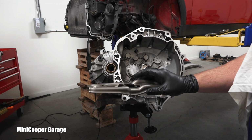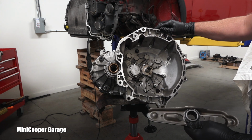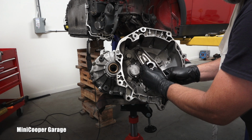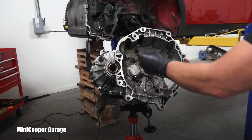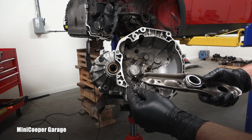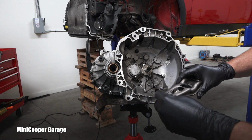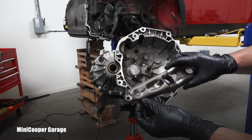To install this whole thing, the lever with the bearing, it's basically the opposite of what I did just 20 minutes ago. So I will introduce it simultaneously up here, but also watching that throwout bearing. To make it easy on myself, I will actually remove that retaining clip, right. I will first install it on this lever, right, it's easier, and I have it in my hand like this. Yeah, that's the way. Nice click, right, you heard it.